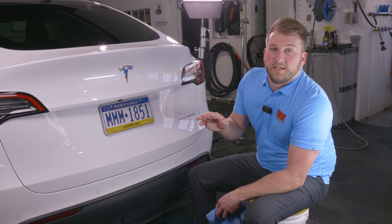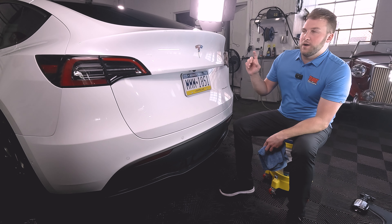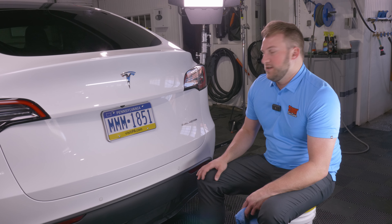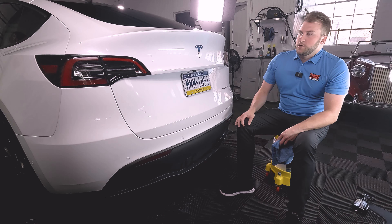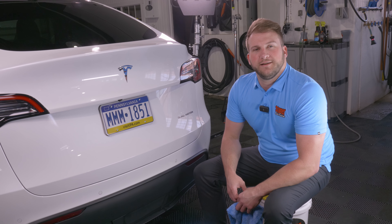For professional results, you definitely want to sneak in that step of polishing the paint and making those corrections to fix the micro-marring. But on a white car or silver car, you can usually get away with skipping it once or twice. In a short process of about 30 minutes, we got smooth paint that's protected for six months with very minimal marring or scratching, because of the high lubricity in that iron remover step. If you have any questions or different ways of doing it, let us know in the comments below so we can help the whole community out. Thanks for watching and we'll see you in the next one.